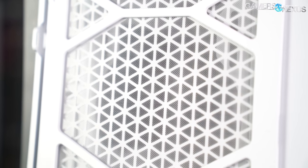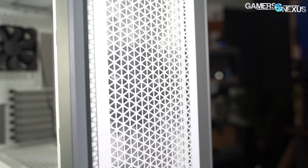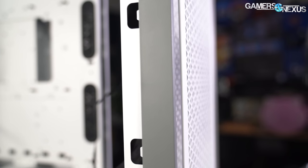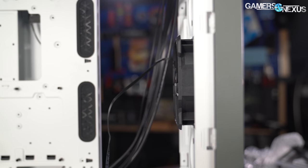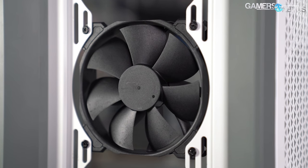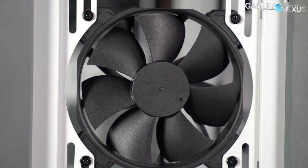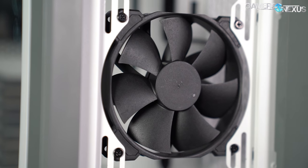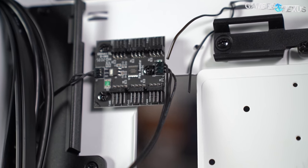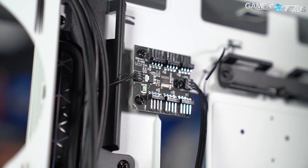The side filter locks into place in the side panel, preventing it from sliding around during installation — which can be an issue in other cases with side vents like the Lian Li O11 Dynamic. Distance between the front fans and the front panel has increased from 2cm in the 4000D to 3cm in the 5000D; top panel clearance is also 3cm. The fans included are almost exactly the same two 120mm fans as the 4000D. They're 4-pin PWM and connected by default to a 6-way PWM fan hub. We'd like to see better fans included at this higher price point, but Corsair has reserved that for the 5000X.